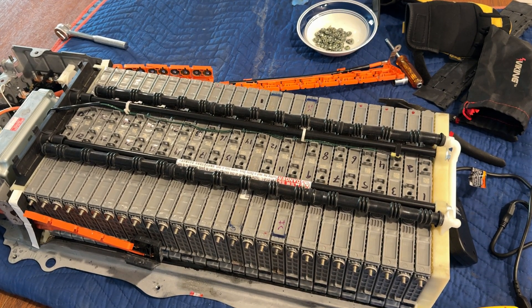This is the battery out of my 2008 Toyota Prius. It's showing the red triangle of death. I put the OBD2 sensor on and it's showing that cell bank number five has gone bad. There are actually two cells per cell bank on what the sensor reads, so I'm trying to find which cell is actually bad.